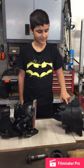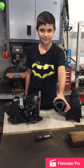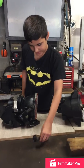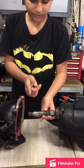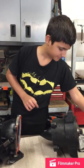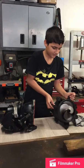In the previous video starring my GTX, we had a look inside this impeller housing. What we found wasn't so good. This is melted. On the outside it looks fine, but on the inside, not so good. We couldn't salvage this nose cone. And if water got in that, which it most likely did, this drive shaft got rusty, the bearings melted off, and we can't salvage this either. So, we tried to salvage as much as we can, but we ended up only salvaging the impeller.